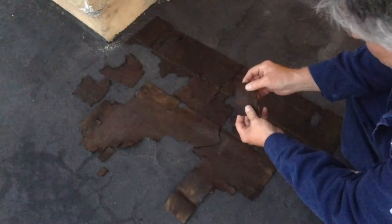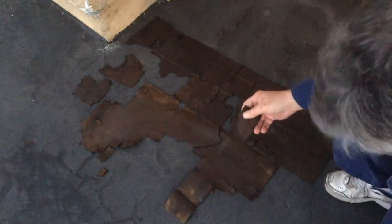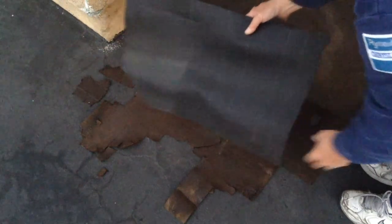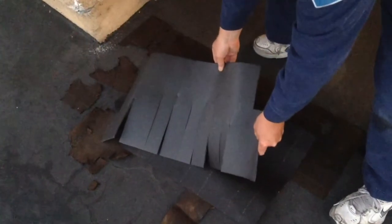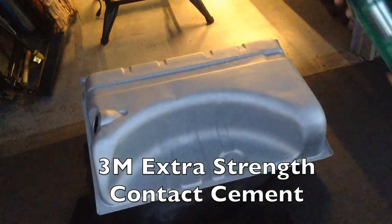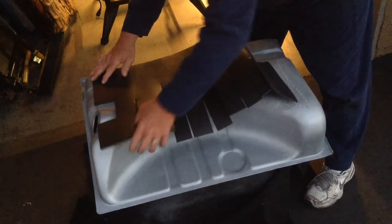The factory placed a black felt pad on top of the tank between the tank and the chassis for insulation, sound deadening, and damage prevention. The original ones were 0.08 inches thick, similar to what's used on roofing on homes. You can purchase aftermarket paper or foam insulation. Some people use 30-pound roofing felt, but that is only 0.06 inches thick. Carefully save the tar paper gasket that sits on top of your tank — you can use it as a template. I use the Detroit Muscle Technology OEM Style Gas Tank Pad. Spray 3M adhesive to the top of the gas tank and locate the insulation pad on top of the tank and secure.